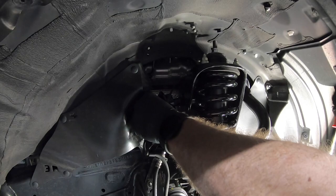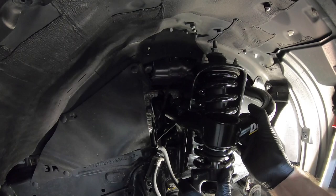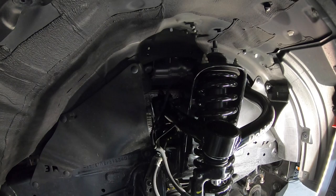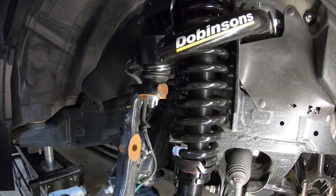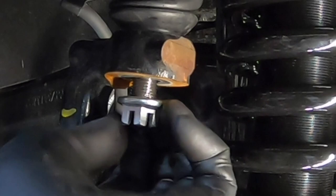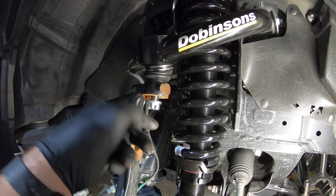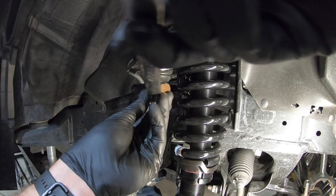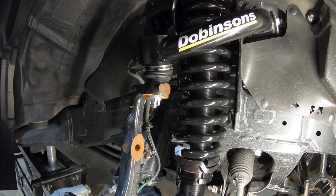At this juncture, we can reinstall our upright. I usually find it easier to do it first. Start the nut. And I'll show you a little something about castellated nuts. Okay, so castellated nut, you can see the hole is at a certain depth. Some ball joints take a washer right here and some don't. And the thing you gotta make sure is that the cotter pin is gonna be fully seated inside that castellation. You don't want it to loosen itself, but in the case of like a wheel bearing, you don't want it to over tighten itself either. Ask me how I know.